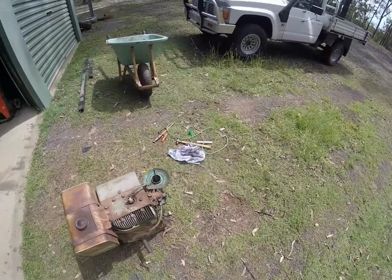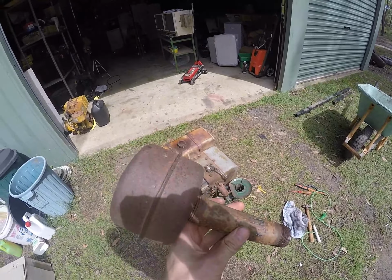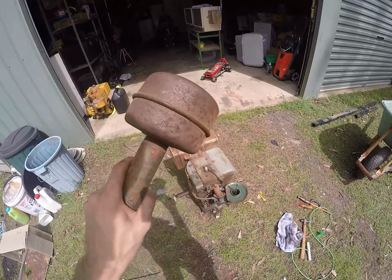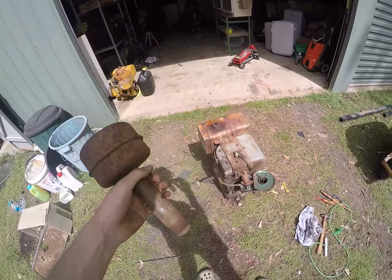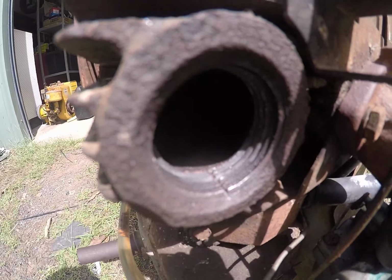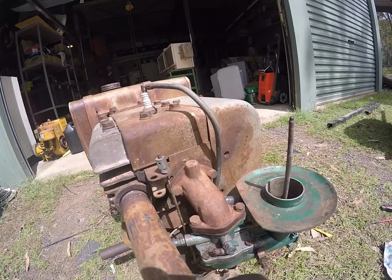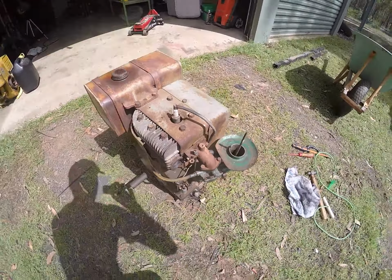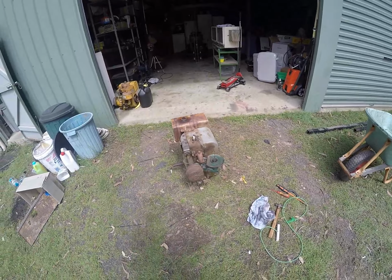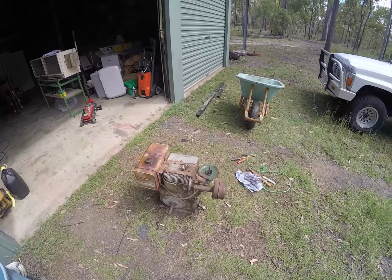Alright, I've got this thing out here, fuel line's all plumbed up, all the fuel system is working fine now, and it's time to put a muffler on this thing. I rebuilt this one off the other one, it was like a little rust maraca, but yeah, it's pretty clear now, just a little bit left in it, and I've taken the time to get out all of those threads that were stuck in there from when the old one broke off. So they're all out now, so this should just thread in there, and this thing should be muffled, all well and good. So the muffler's on there now, and it's time to see if this thing will start up and run all right. Then I can put the air cleaner on it and get it tuned nicely to get it running consistently and pretty well.